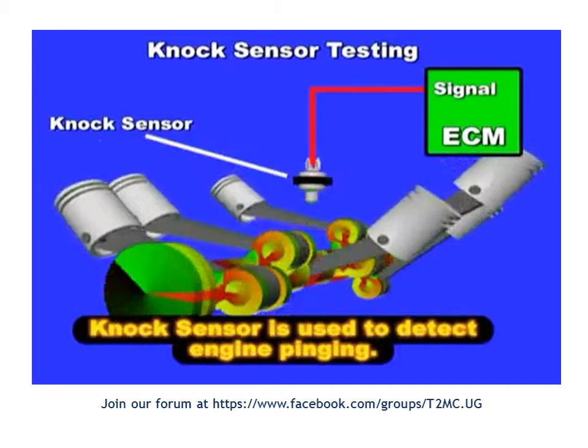When you bring your vehicle to Talk to My Car and we diagnose it on our equipment and inform you that you have a knock sensor code, here is what you should check. Check the integrity of the signal wire. Check the ground connection — on a one-wire sensor that usually doesn't need much attention since the ground is achieved through the mounting. You can unscrew the sensor, make sure the threads on the sensor and on the engine block are clean, and put it back.